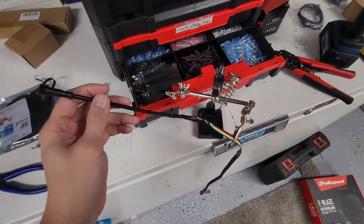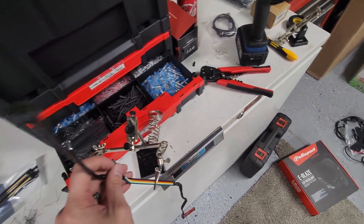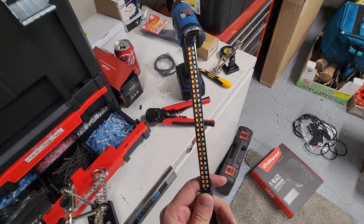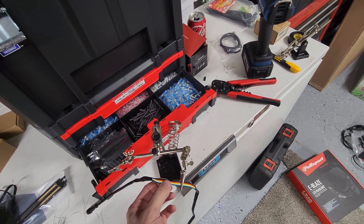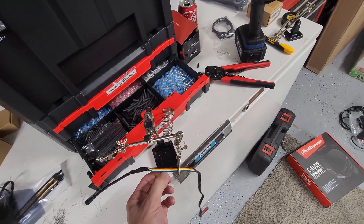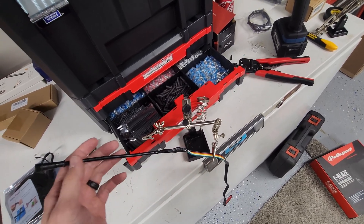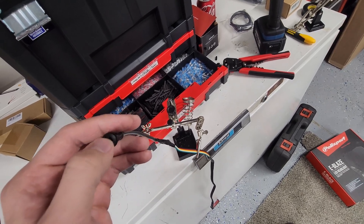Okay, this is how I connect everything. I have these nice watertight connectors that I use, and I just match up the colors corresponding to my wiring diagram. I'll also put that in the description in case anybody's wondering what the wiring diagram looks like for these lights, specifically with the setup that I'm making. But if you don't know how to wire it, the best thing to do is connect the negative to ground, positive to power, and then connect the other three wires to positive one at a time to figure out what they all do. That's kind of a general rule of thumb, and then to make your own wiring diagram, you'd basically just try and remember exactly what color everything is and what colors need to be connected to what.